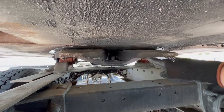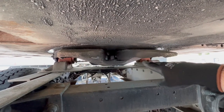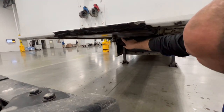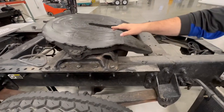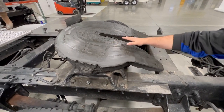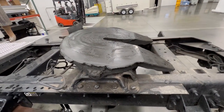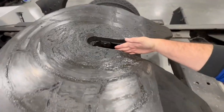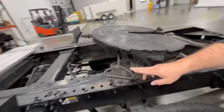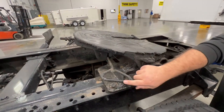There's a king pin coming off the trailer — your king pin is properly mounted, secured, not cracked, bent, or broken. These are your locking jaws — you can see them locked around the shank of the king pin. Make sure they're properly mounted and secured. The apron and king pin are connected to the trailer. Your fifth wheel and skid plate are properly mounted, secured, not cracked, bent, or broken, and properly greased. When connected to the trailer against the apron, there should be no space in between. When you connect to the trailer, the king pin slides up into your locking jaws, and when it locks, the locking jaws wrap around the shank of the king pin. The fifth wheel release handle is currently in the release position — once the king pin comes in and locks, this will go into the locked position.